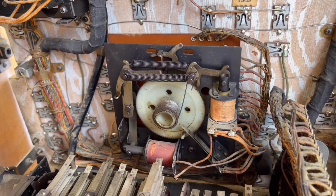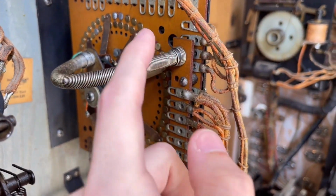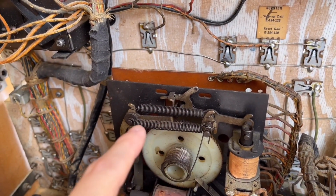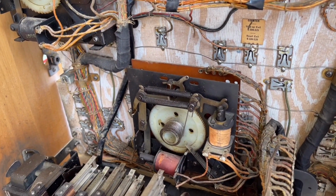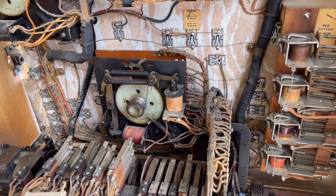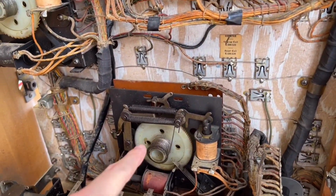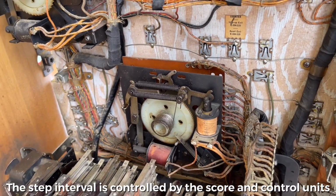And this stepper is different from all of the other ones in that it doesn't use little round contacts like this. It actually uses a PCB on the backside, and the wipers that are on it just go across big copper contacts on that PCB. And this unit is responsible for breaking the circuit once the counter reaches the correct number of credits depending on the odds that you've lit on the back glass. So every so often when the counter is stepping up to give you credits, this will step. And so once that reaches a particular step, then it will stop giving credits.